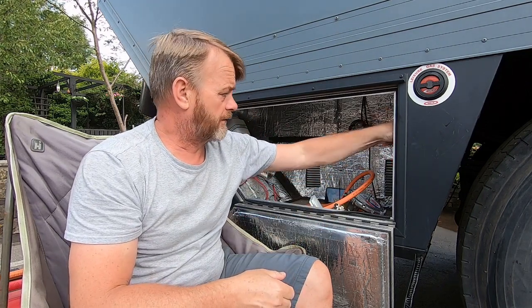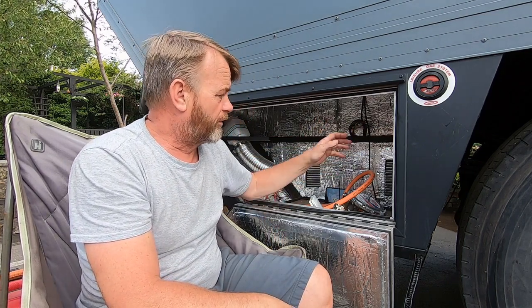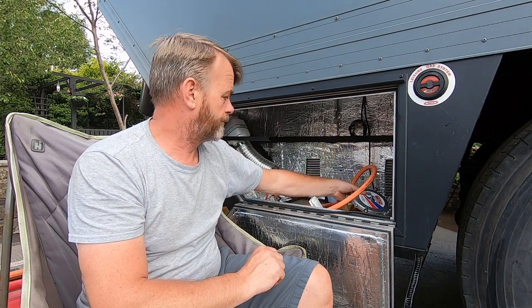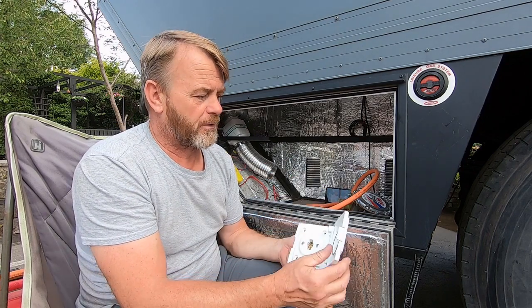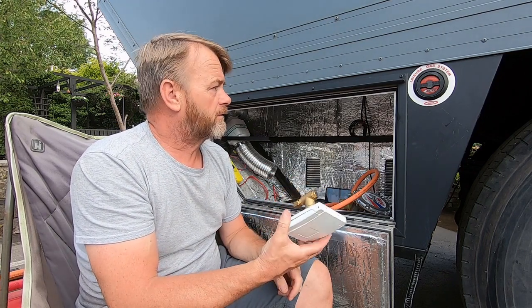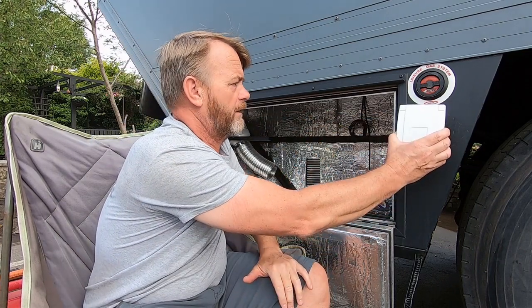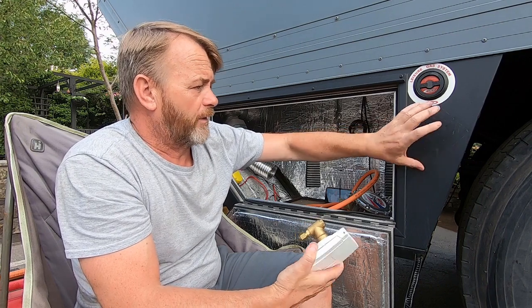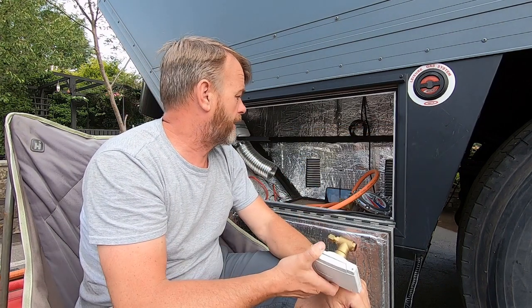So what a challenging morning. We've got the copper pipe now all the way along inside and down into this cupboard. So I'm looking now at maybe doing the soundproofing, looking at where we're going to fit the secondary regulator, and also mounting up the barbecue outlet. I removed the sticker off here, so we're going to mount that through there — mask and tape it up, cut the 57mm hole there, and then get this mounted in. And then obviously start working on the pipework on the inside.